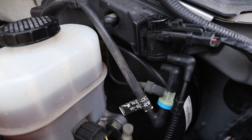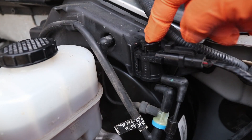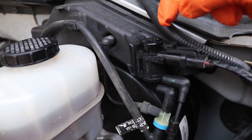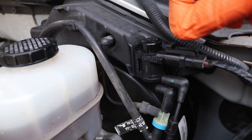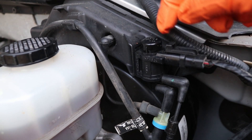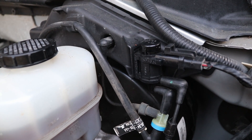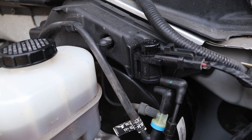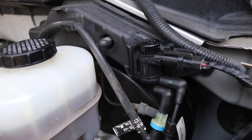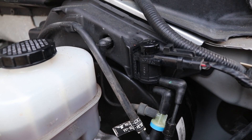In this case I feel like it's going to be the IWE bleeding itself off. This is your vacuum solenoid. You can check these solenoids with a bi-directional scan tool — you can command it on and it'll click, and command it off and it'll also click. If you don't have a bi-directional scan tool, a simple way is to have someone get in the truck, crank it up, and go from two-wheel drive to four-wheel drive. You should hear it click as they do it, which lets you know the solenoid is working properly.